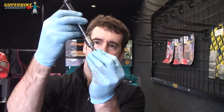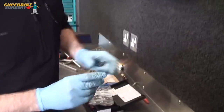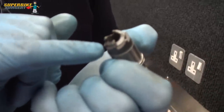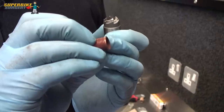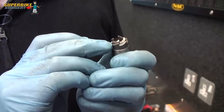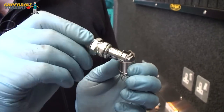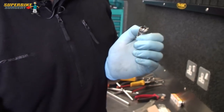So that's in the cylinder head. We turn the driver which turns this seat cutting tool. This seat cutting tool does two things - there are two cutting tips, one on the inside and one on the outside. The one on the inside cuts a countersink for this bit of the insert, so the insert can actually sort of disappear inside the head ever so slightly. And then the outside edge cuts a new gasket seat for the spark plug washer, so when the spark plug goes in it's got a nice clean seat exactly at 90 degrees so the spark plug can seal properly.